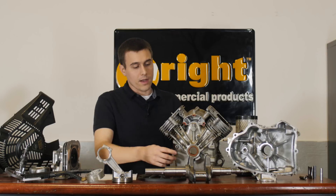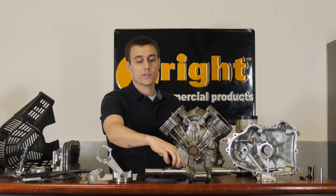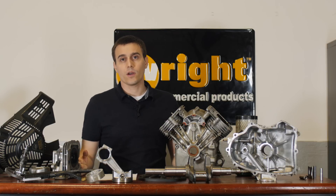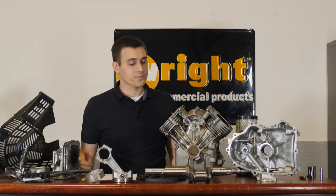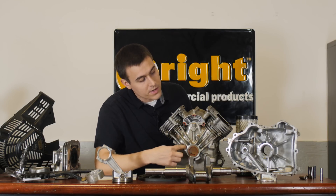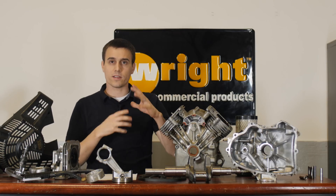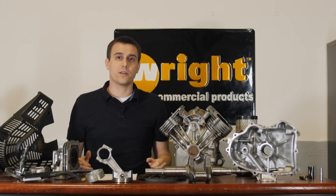We also have bearing inserts on both the top and the bottom of the engine — this isn't always the case, and it's really good to have. We also have a long bearing surface, which is good for a commercial lawnmower that has a lot of belt tension to the blade drive. This engine is very stiff compared to other engines out there like this. You can see these ribs are really strong and heavy, and there's also a lot of rigid ribbing and bracing inside. When the engine's stiff, it causes all the parts that are moving and wearing against each other to be aligned more accurately, which adds life and durability to your engine.